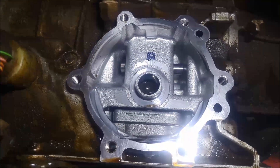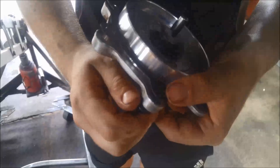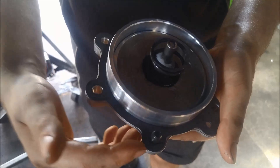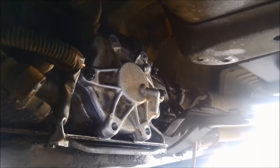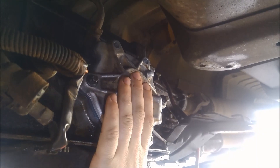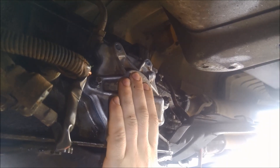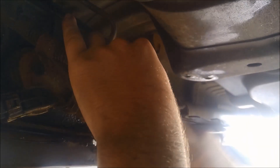You can see where that pin pushes on the band. The spring goes in and the gasket will hold with two bolts either side. Put it in, made sure the pin's in that hole, and put these two bolts in just a couple of threads. We're just going to make sure there's a bit of detent or springiness, then do it up evenly.